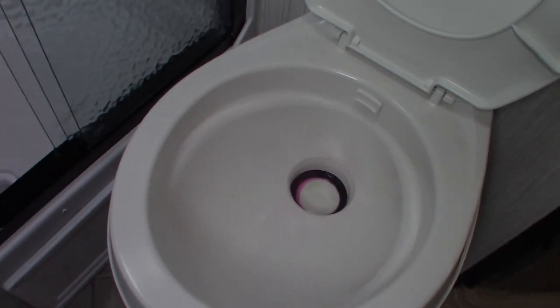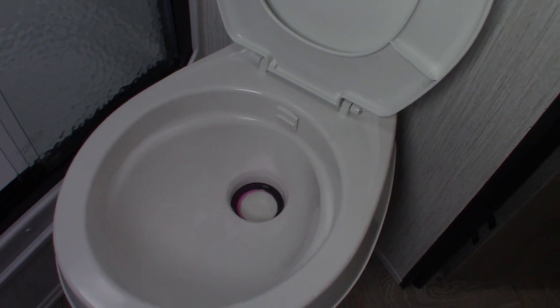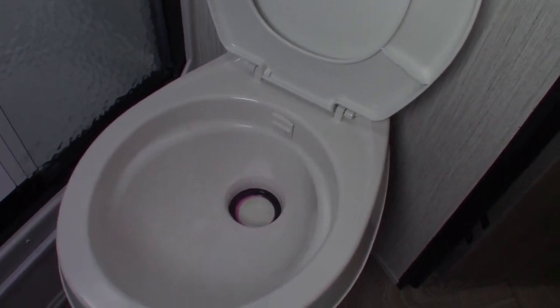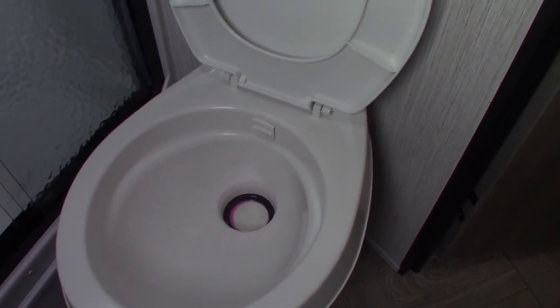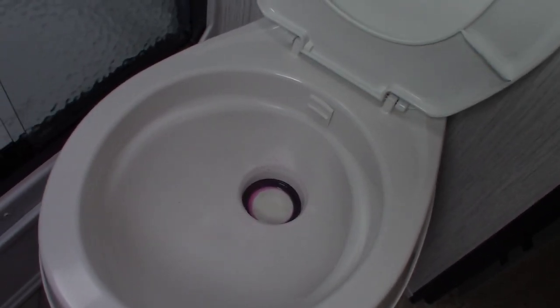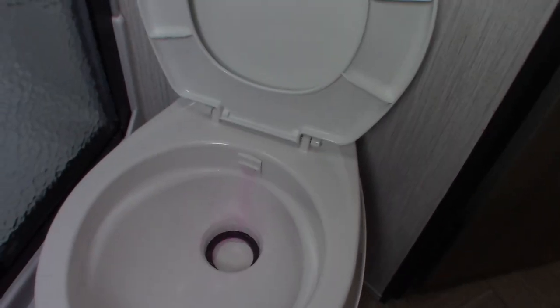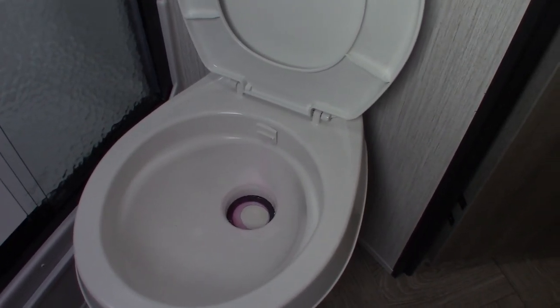The black tank is directly below. When you get to the campground it should be dry — dumped, flushed, and empty. You can't use it dry because the smell will be terrible and you can get clogged up. So what you do is put a dose of chemical in here after you've hooked up the power and water, then stand on the pedal and let about a gallon of water or more flow into the tank below along with the chemical. Then it's ready to be used. If you use it dry without doing that, it'll get clogged up and it'll smell terrible — it's one of those mistakes you'd only make once.